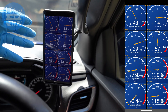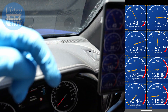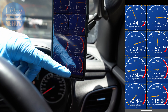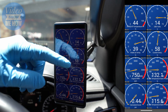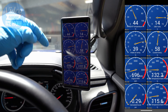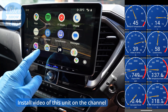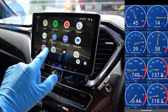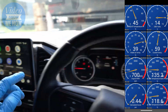I normally run this when I'm on the beach or towing — that's why I like having it on the phone arm mount setup, so I can see what's really going on. You can see when you're doing an EGT burn — the temperature spikes up to around 650 degrees before dropping back down. You can see when burns are happening, check coolant temp going up big hills or on the beach, and it gives you an idea of when to take it easy. I know in some vehicles you can get it on the big screen — this is the Alpine Halo unit. I haven't worked out how to integrate it with Android Auto yet, but if you know how, let me know in the comments.